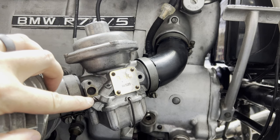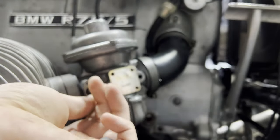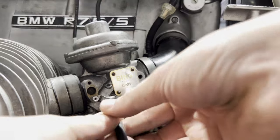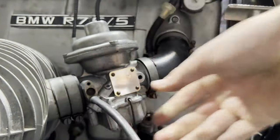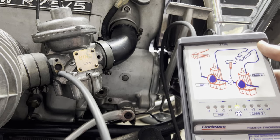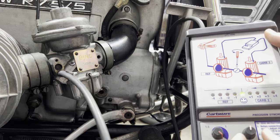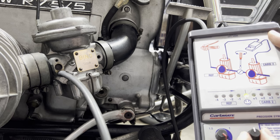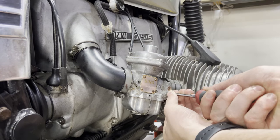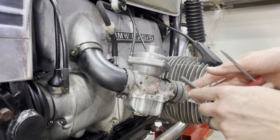What I'm going to do now is — you can see this little flathead screw on the side of the carburetor. That's your little vacuum port. I'm going to undo this small screw and set that aside. I have a Carb Mate right here — I'll hook the hoses right up to the port there and do that on both the left and right hand side. The tool I am using is a Carb Mate, a pretty nice tool. You can set your resolution there — it's electronic. And then also your offset, so you want to get that set up right in the middle, and this is going to give you a really accurate reading. We'll now undo the flathead on the right hand side carburetor, set that screw aside, and hook up one of the hoses.